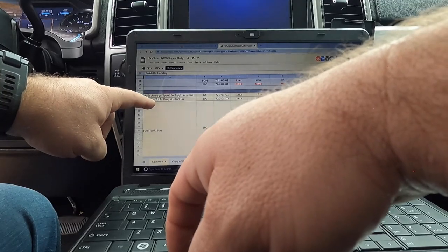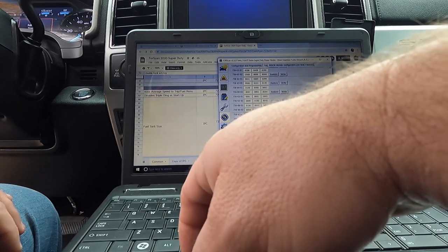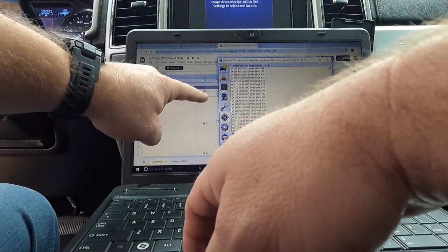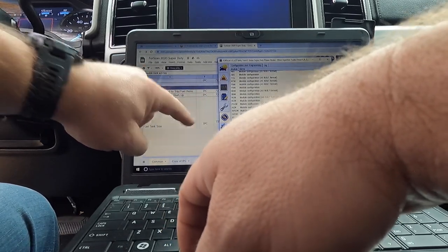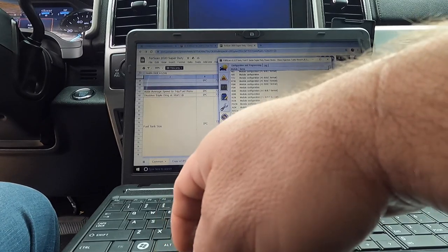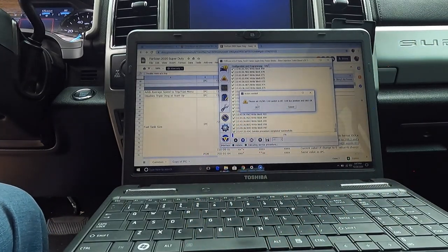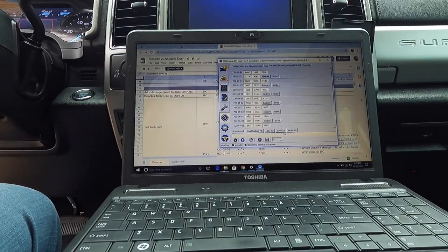So, driver door ajar. All right, let's go find all these other beeps. Here we go. Disabled door chime. So we're going to stop here because we're in the body control module. We've got to go to the IPC. So we'll go down, IPC module. Play. Switch to MS. Done deal. Hit OK. Hit OK.